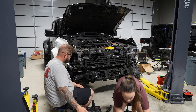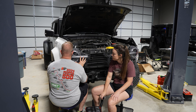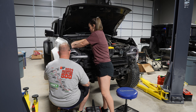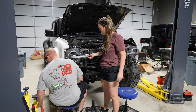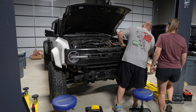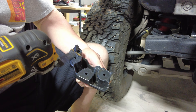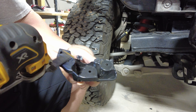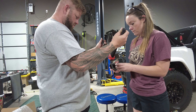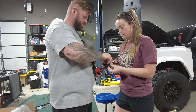When you get to the headlights, you might need to make a little more room for the headlight to fit properly. We put them on, looked, and needed a little bit more space, so we used a dremel to make fine-tuning adjustments to the fenders. For the most part you don't have to do much, but we did have to do some. To attach the front valence, you'll need to take these plastic pieces and remove the tabs or they won't fit anymore. After removing the tabs, they fit in the space. You'll need to drill through and put an insert so you can attach these to the fender.